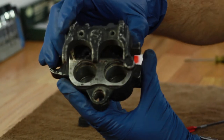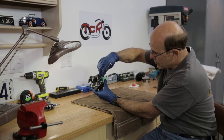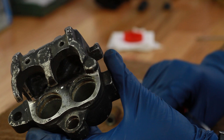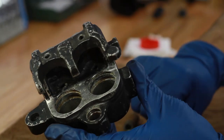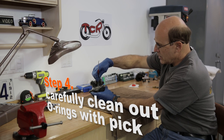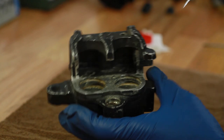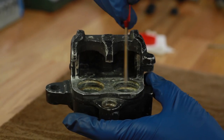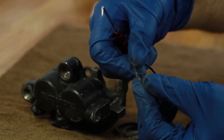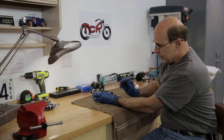Now this is the important part. Look closely in the bore and you're going to see all kinds of white crud built up in the grooves. These o-rings are what do all the work as far as providing a seal, keeping fluid from leaking out, and providing a tight fit for the piston travel. You have to clean these grooves out carefully. You can take a pick and go around and scrape out the bulk of it. A lot of times brake spray won't take this out — you've got to really scrape it out good first. The reason this is important is because that crud behind the o-ring has actually caused it to push out a little bit, and they're going to reach a point where the piston is going to start to drag — it's going to be so tight it's not going to want to go out or go back in.